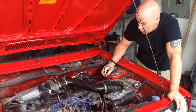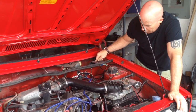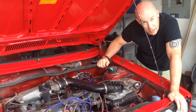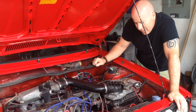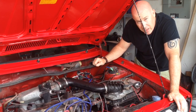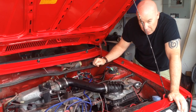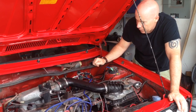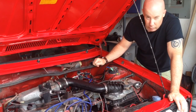What I'm going to do is disconnect the ground on the ignition module. One of the wires goes to the brown wire on the ignition module, and the other wire is going straight to the ground on the battery. So all it is doing is disconnecting the ground from the ignition module when you flip the switch. If anybody knows exactly how that affects the fuel pump, just leave that information in the comments — I'm not exactly sure how that works. I know that the fuel pump should just kick on for a few seconds when you turn the key on just to prime the system and then cut back out unless the engine is running. In any case, I'm glad I've determined exactly where that's going and I'll have to do a little bit more research to see how to rectify the situation.